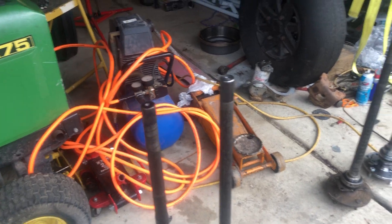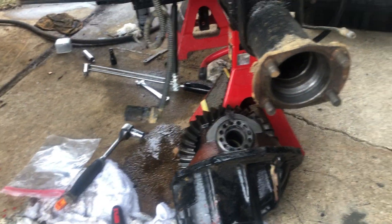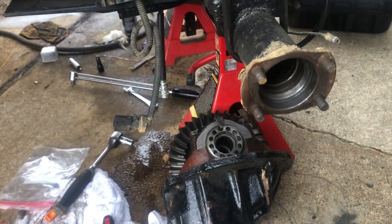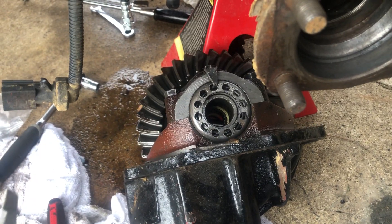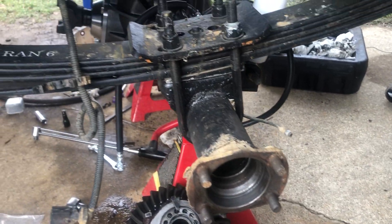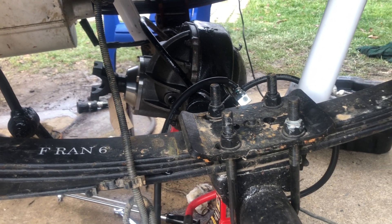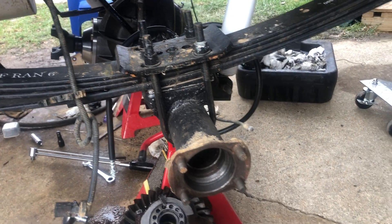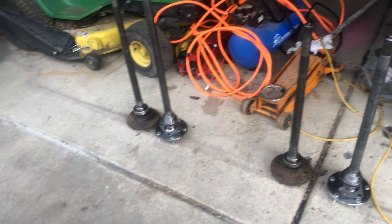The big thing with these axle shafts is you actually have to upgrade your carrier on your rear end to fit these axle shafts. My rear end grenaded — I'll do a separate video on disassembling it — but I pulled out so many pieces and so much metal from this 9-inch. I just got done putting a new one in and that has a 31 spline carrier. So it's not just a simple 'I'll buy the axles and put them in' — it's not like that. This is for people who are looking to get a new rear end or build their own rear end.